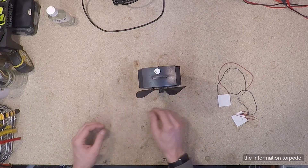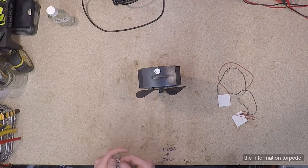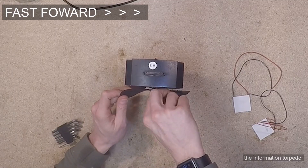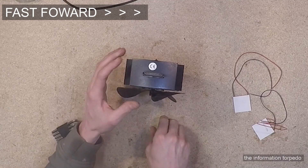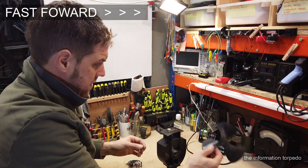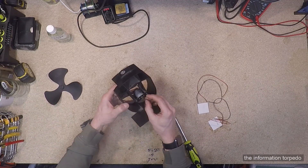I'm going to fast-forward the dismantling bits. First thing to do is take off the fan blade — there's one grub screw on it. I undid that but it wouldn't come off, so I gently prised it with a screwdriver. Be careful not to damage the motor or the bearings. The fan blade came off with a little bit of persuasion; it had quite a lot of fluff and dirt on it which also needs to be removed.